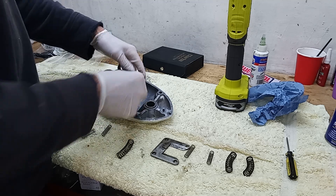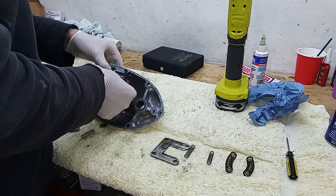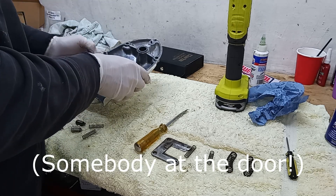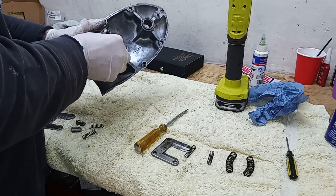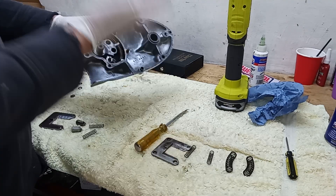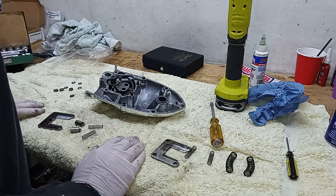As you can see they're going to be quite tight. Make sure it's seated properly. There we go - you can see those springs are tight. That's what returns the gear lever back to its nice sharp position. If the gear lever is a bit sloppy or lazy it's probably these springs, because they hold it really tight. That's why I always change those springs, even though that was a bit more of a torque than I was expecting.